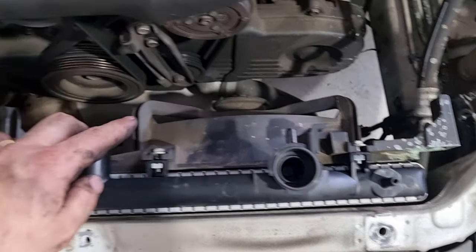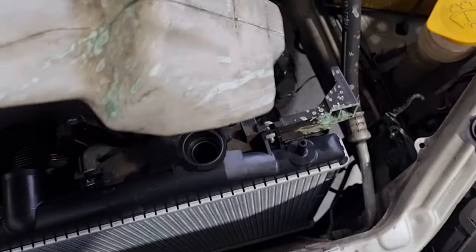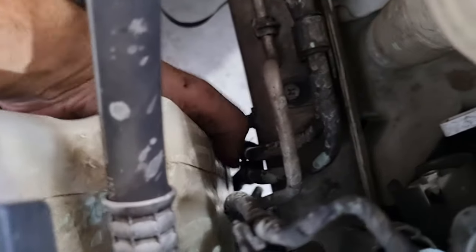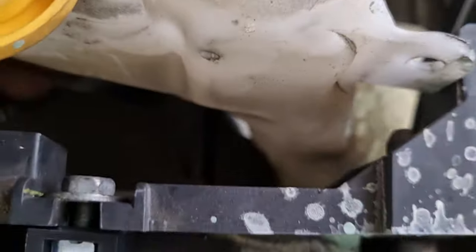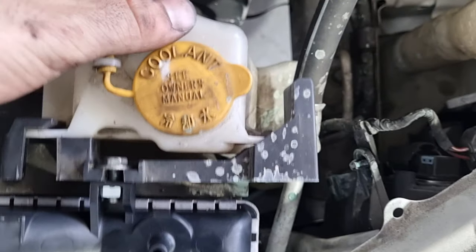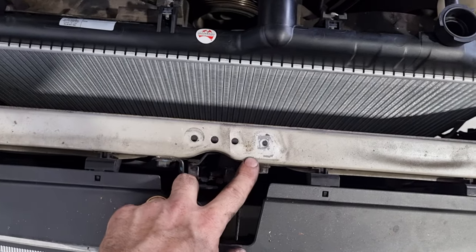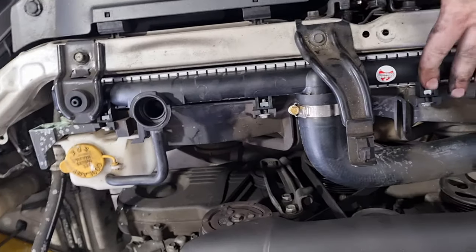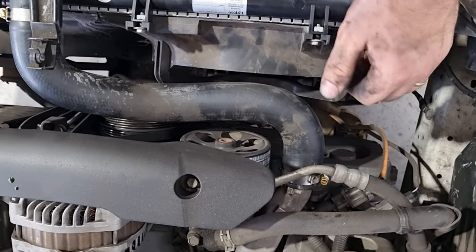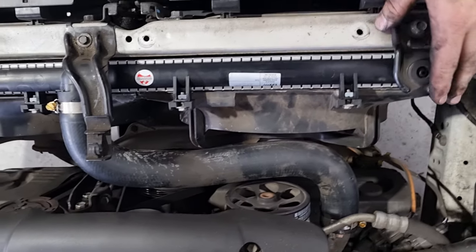Back up top, just put the bolts into the fans and nip them up — they have cap nuts, so do them up on the 10 mil. We can put our coolant bottle in — it literally just goes down the side. Make sure it sits in at the bottom, remembering that it sits in the fan. Slide it in the side there and then just squeeze it together. Put your hose on. Next we can put our radiator brackets and the bracket for the bonnet strut. The brackets are on, the radiator is all mounted, everything's looking sweet. Put the top hose on with a new clamp — still worth changing that clamp.